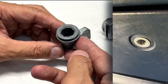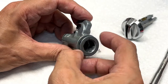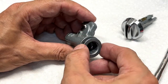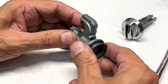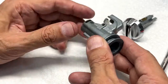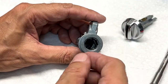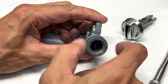When you remove the knob, at that point you can also remove the whole latch assembly out of the vehicle. This thing is secured by this lock ring here, which has a hex shape inside. I don't have anything that actually fits this right, but I'll show you a trick on how to tighten it — because sometimes over the years it vibrates and loosens, so you end up with a noisy, rattling glove box door. To fix this, remove the tumbler so you can actually tighten this lock ring.